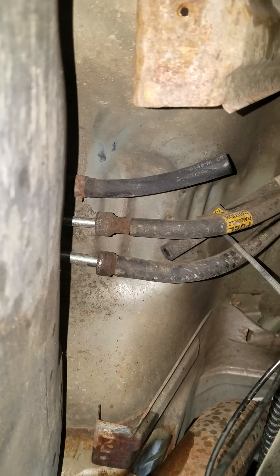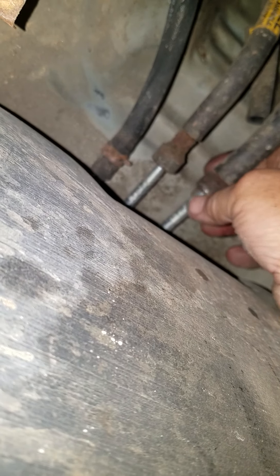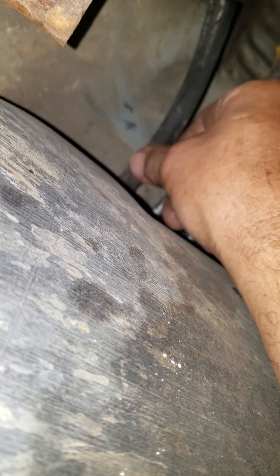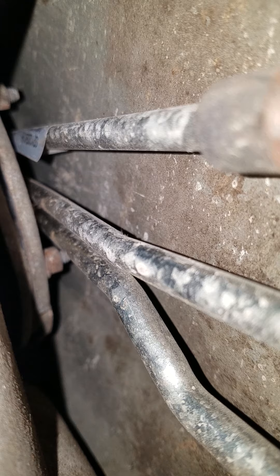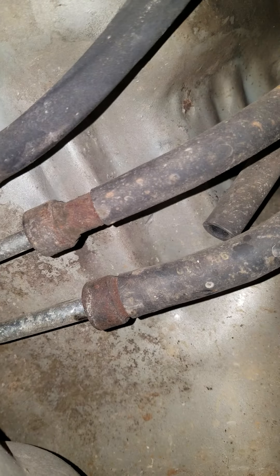You can see your fuel lines up there. As soon as we get this thing dropped down enough to access the fuel lines, we're going to take care of business. These little guys here use spring spiral clamps — I could probably take them off right here. I'm not going to video that because gasoline gets everywhere. That's the fuel pump there, that's what we're changing — fuel filter and fuel pump. I'll pop those lines off, take these straps out, drop this sucker down, and get it swapped out.